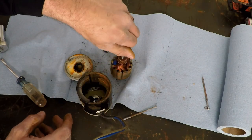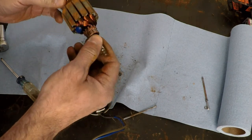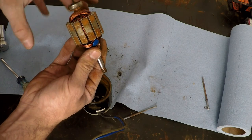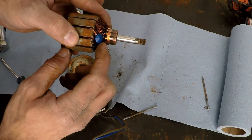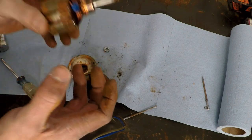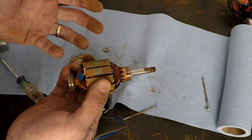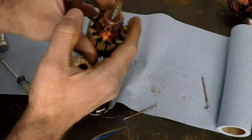As the commutator switches from one segment to another, it activates different electromagnets, and those fight our permanent magnets' electrical fields, causing it to sit inside and spin with a certain amount of force. We have some basic parts: number one, we have a shaft — everything is mounted on this central shaft — and we have bearings on the ends. We're talking about an armature, and a lot of times armature windings fail. On starter motors you'll have a dead segment, which means the connection point at the commutator has gotten bad or one of the wires is broken and it's no longer continuous. These continuous loops need to be continuous; otherwise they're not passing current, not generating an electromagnetic field.